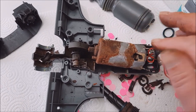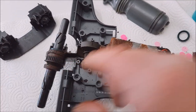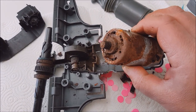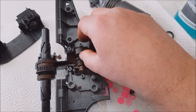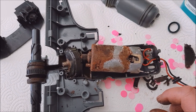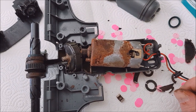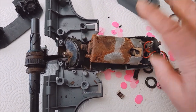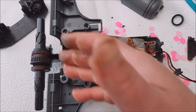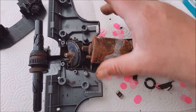So I decided to chop it up and warn you guys. It really works when it works — it's a beauty. It's very robustly built, tight-fitting tolerance plastics, not a cheap device to make — a lot of engineering went in — including a lot of engineering for programmed obsolescence. This is the smoking gun: a reduction gear supposed to work in a wet environment where everything is made so that the slightest humidity corrodes essential parts, making the device unserviceable. There's no way to keep humidity out without any seals or o-rings.